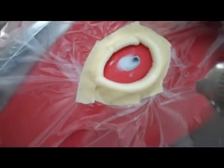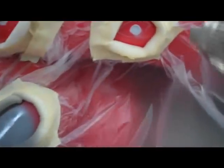That you see in there instead of a hard line. I got that door aperture tape there. That door aperture tape kind of keeps you from getting that hard line from the tape, making it easier to sand. Just dusting in some of this — it's a topcoat-type foam in here. Just a little dark coat.